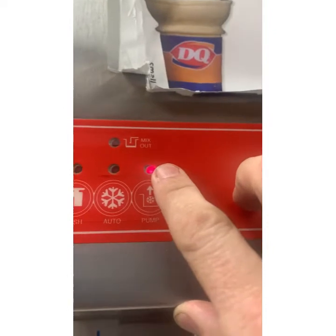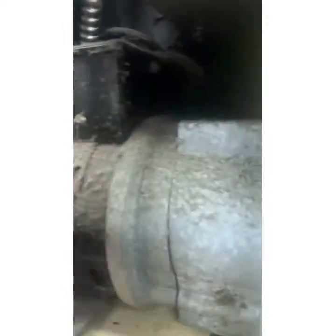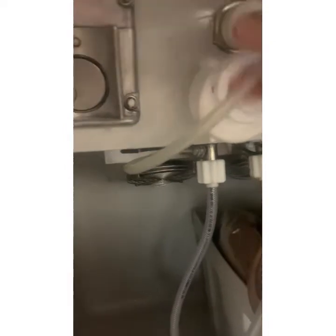So that's it — spinning. There's a little overload button right here. It's tripped. Okay, so if we're not off mechanically, then we could be off on a pressure switch.